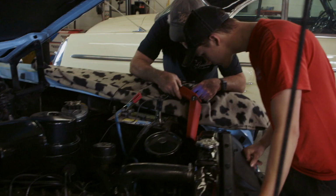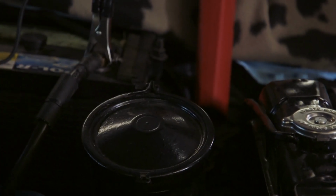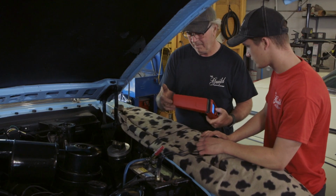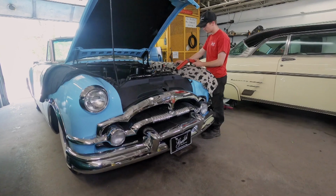Okay, you know what, though? We've got to get the idle down a little bit. It's at 920, so we want to get the RPM down. Well, Tommy's got the Packard carburetor rebuilt and reinstalled, so I got Ron and him to get on it, set the timing, set up the carb, and get it ready for the road test.